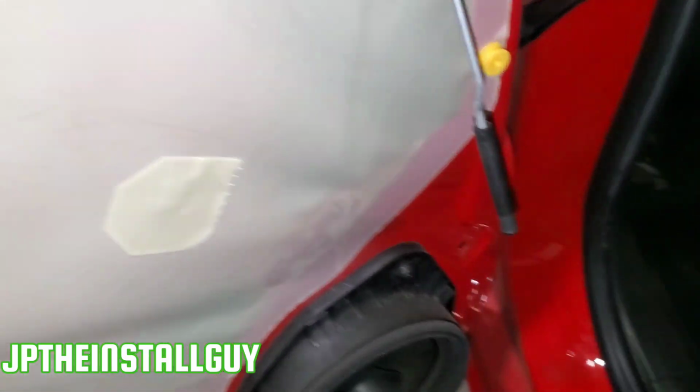I come over here and put my hand right in this little part, little pressure, and literally all the clips just got done popping out. Now that's literally right behind. I'm gonna do this one hand, put my knee at the bottom for some pressure, and we're gonna lift this door up over the lock unlock little situation. It's gonna drop down, but it does go up like this.